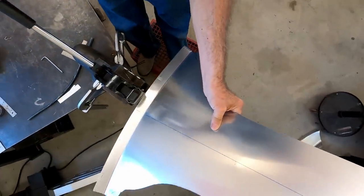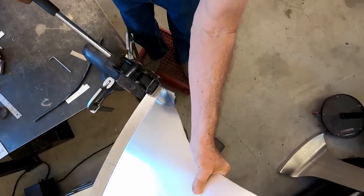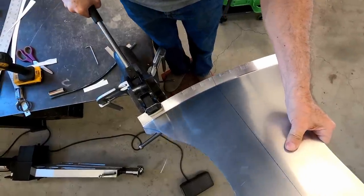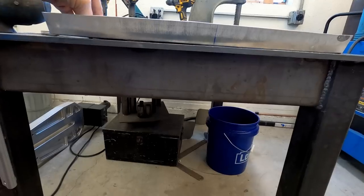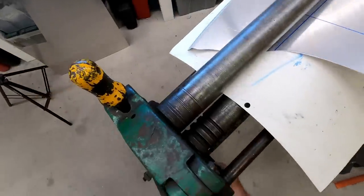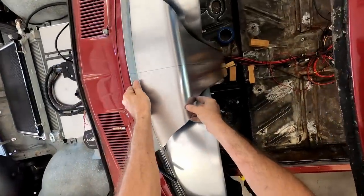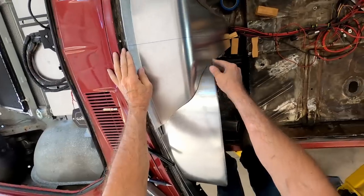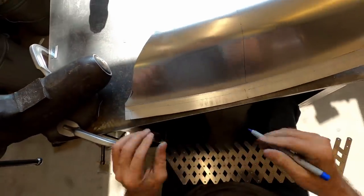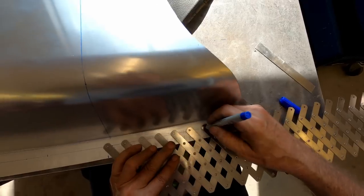Skipping ahead — after the template gauge was made, it was cut out and transferred over to aluminum. Then a tipping edge was made on the piece. Because of the tall flange, it took a lot of shrinking to get it flat — I bet I made 10 passes, a little at a time. To make this tight radius, I cranked up the tensioners in place and only rotated it a little. It still needed trimming, but it now fits pretty good. This is that handy rivet spacer I use to evenly mark and space holes — since I get a lot of requests on where to get one, I'll drop a link in the description.